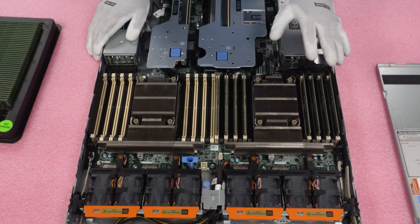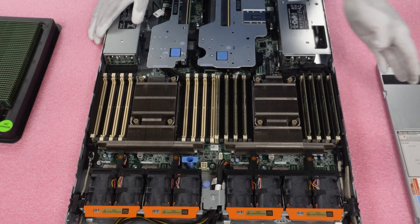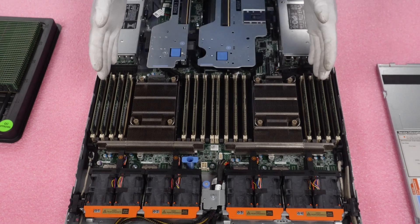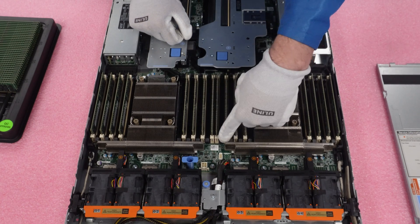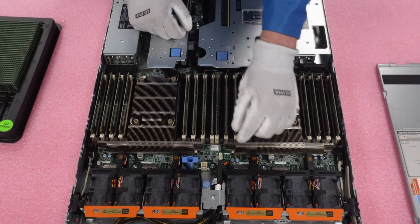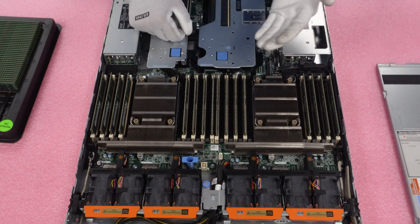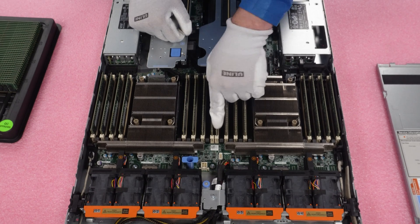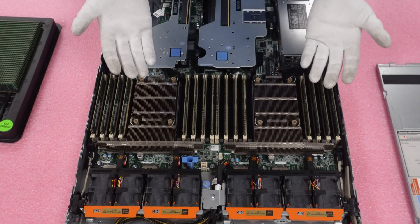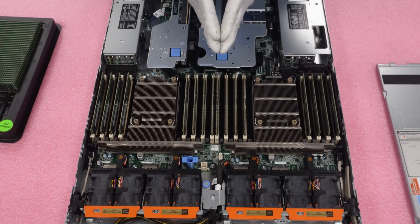So that's how you do it. Now that we've shown you the tips and tricks and identified the DIMM slots, we installed the first 16 — all the white slots. I always look and make sure all my tabs are fully closed, because if anything is sticking out and not fully inserted you'll see it. Even a very minor difference like that is the difference between a module being properly installed or not. This is the number one issue we see when people do upgrades — improper seating because they're going too fast or being too gentle. Just make sure you seat everything properly.